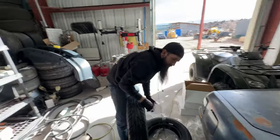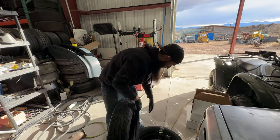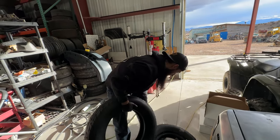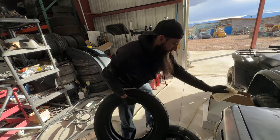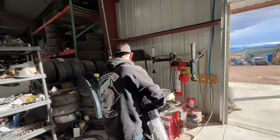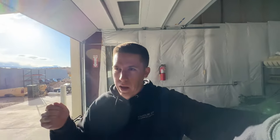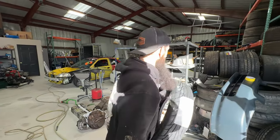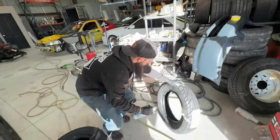I think it has like a weird 230 rear gear. Real tall. It wasn't happening. It also needs a trans brake and a two-step and all the things. It actually has a little two-step, but it's super delayed. It's like the poor man's two-step, where you hold it between gears, the sloppy two-step. Yeah, we got the sloppy trans brake. It locks itself in third gear and then drops it to first, but not very fast.